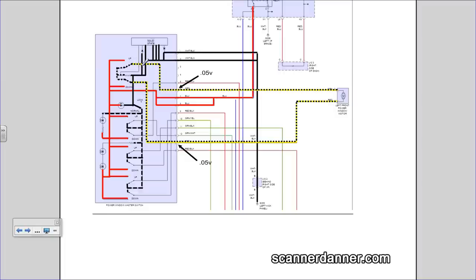What we know for sure — these two circuits on the voltmeter showed 0.05 and 0.05. Not the voltmeter, the power probe 4 showed a ground — the green LED was lit. Both circuits in the natural state have grounds. There's a resistor right here — it might be a PTC resistor, a current-limiting device that really doesn't have any resistance initially and may protect the circuit. The other window circuits down here are not using resistors, so that resistor is definitely associated with the auto down feature. In any case, there are constant grounds in the neutral position — the switches are connected to ground.